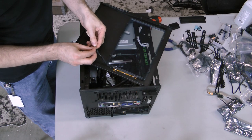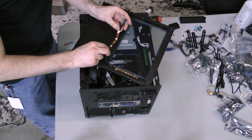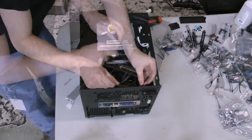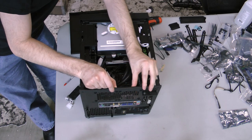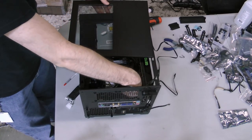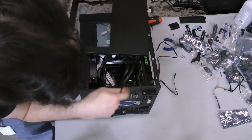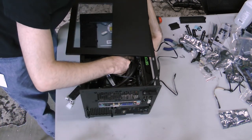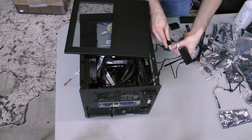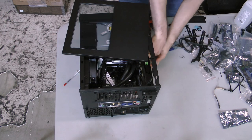You can feel free to skip this step, but I'm going to give this build a little more flair by including a Corsair Link Lighting Node. Peel the adhesive from the backs of the lighting strips and attach them to the underside of the top panel, preferably under the window clamps to keep them out of the way. Next, attach another lighting strip to the rear interior surface of the case, then attach and route its connector cable. The lighting node came with a small Corsair Link cable — connect that to the open header on the H100i water block next to the USB connector, then route it down to join the two lighting strip connectors. Attach the two strip connectors and the Corsair Link cable to the lighting node, then connect the four-pin Molex connector of the lighting node to an open Molex connector from the power supply. Tuck the node and cabling into the bottom well of the 250D.